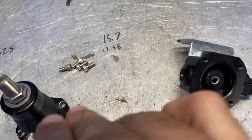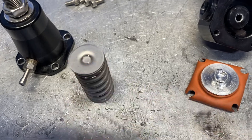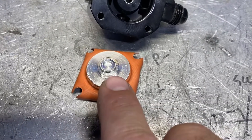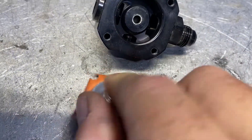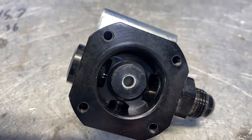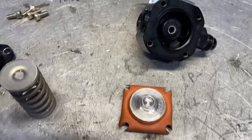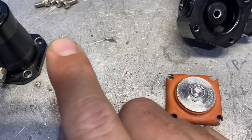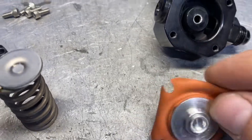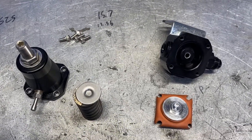Inside that is this coil spring, and there's a spring seat on top — that's what the screw is pushing against to add pressure to the spring. The spring sits on this aluminum spring seat on the top of this diaphragm, pushes down on the diaphragm and jams that steel ball bearing into that hole to regulate the fuel pressure. Your base pressure is set by the spring tension — how hard you're pushing down on it, just spring only — how much you're blocking this hole off. That's where you're going to set your initial base pressure, say 50 PSI or whatever you set it up for.